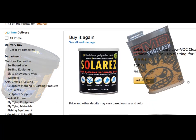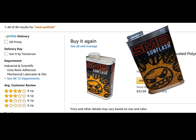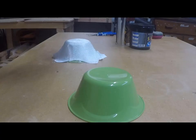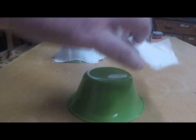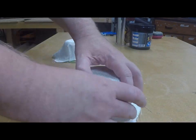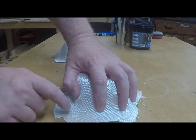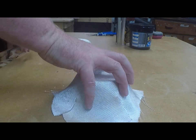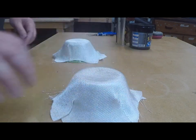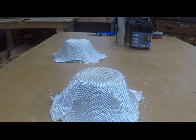Both of these products are available on Amazon, so check the links in the description. Let's head out to the garage and check out the test bench. The fiberglass I'm using is leftover material that I got from a friend. It's a very thick woven fiberglass cloth — a lot thicker than the chop mat we typically use in car audio, and it can be difficult to work with. I've made some relief cuts so it could conform to the mold.